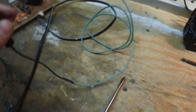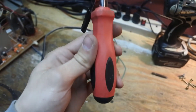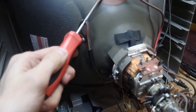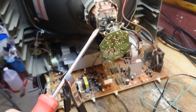or any other wire to another screwdriver — a flat head in this case — that is isolated. That's very important. And then you have a path for the electricity to discharge. What I like to do is just put it under here and discharge all the high voltage that's under there before I work on anything.